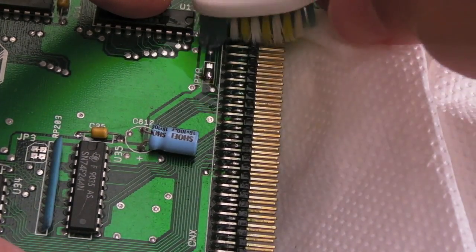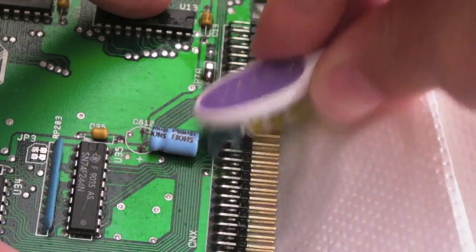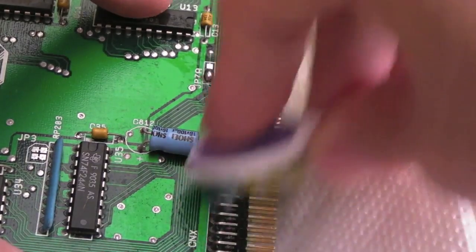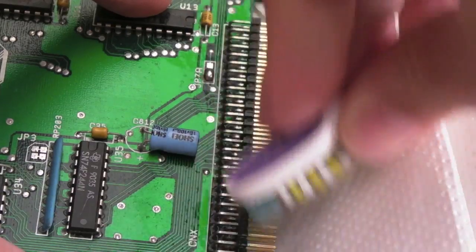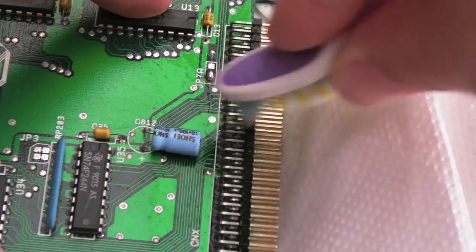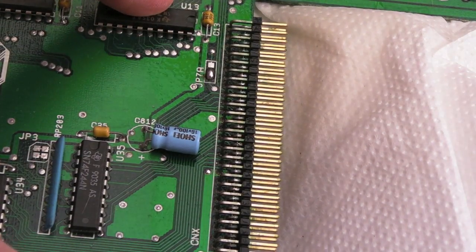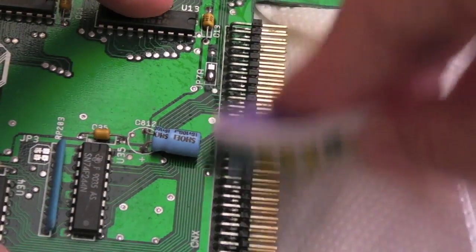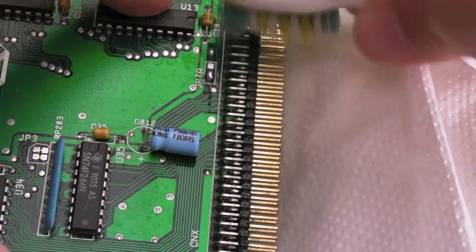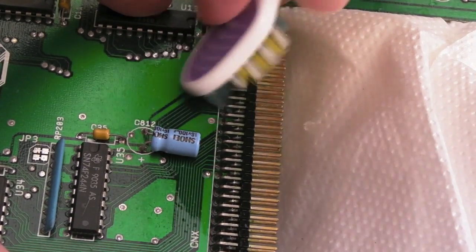The fact we're getting a consistent value with the Guru Meditation makes me think there is a hard fault somewhere that we're not yet understanding. It could just be RAM - I have seen these where bad RAM doesn't give you the green screen you'd expect from the BIOS RAM check. Instead you just get weird Guru things. I've seen on A500s where you don't get a RAM error at all on the BIOS test but as soon as you boot games you start getting crashes, glitches, graphics looking incorrect.